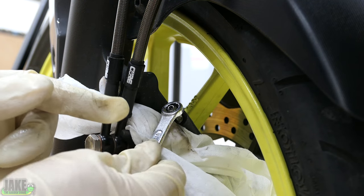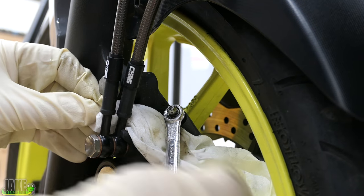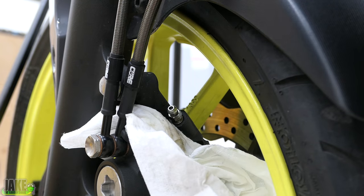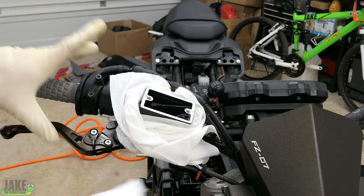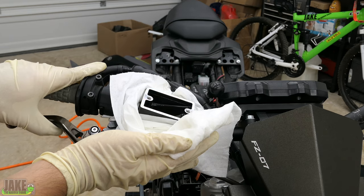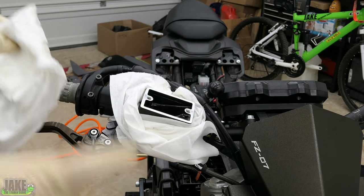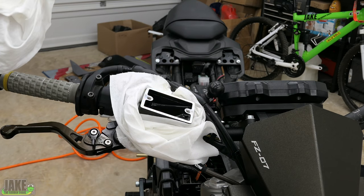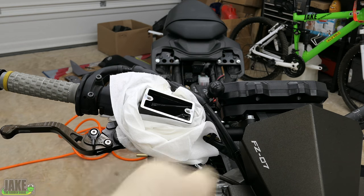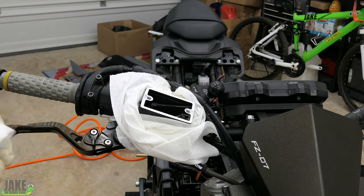See the fluid's going more clear colored now — I don't know how well the camera's picking that up. Tighten this up. We'll just check real fast to see if there's any bubbles in the system. Pull the lever slowly — sometimes this thing likes to squirt a little bit, especially when you let go of it. The brakes feel very firm. No bubbles — so that's good. We can move on to the other side. That's why I love this machine, because it just sucks it so fast. It's almost hard to get a bubble in it, especially when you're just doing a flush like this — pulling the old with the new.